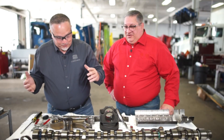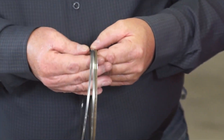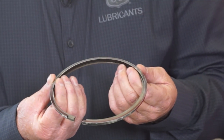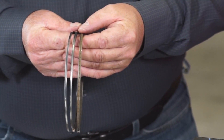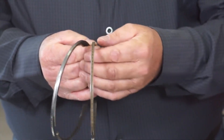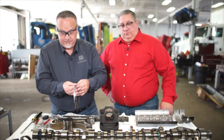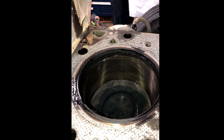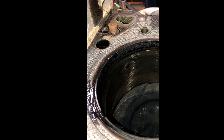Moving into the pistons. These were very impressive to me. Starting with rings — for 700,000 miles, there is very little wear on the ring surfaces, on the faces. Very light trace carbon buildup. No wear steps to be felt. The top ring, we were looking at about 80% contact across the face. The center or scraper ring, we were seeing about 20% contact across the face. And we were getting full contact across the front face of the oil control ring on the landings — trace minimum wear, pristine condition. Moving on to the piston liners: cross hatch is still visible, minimal to little polishing at the turnaround points top and bottom. Overall, minimum wear.